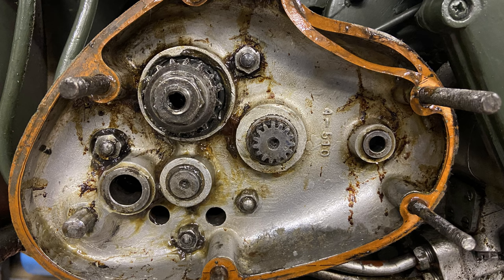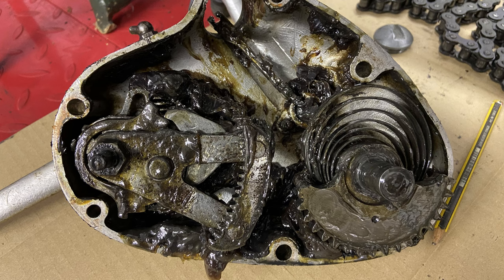Here's the outside of the gearbox now looking a little bit cleaner. And here's the kickstart cover from the inside — on the left you can see the gear selector mechanism, on the right the spring to return the kickstart, and poking out through the hole at the top is the actuator lever for the clutch.